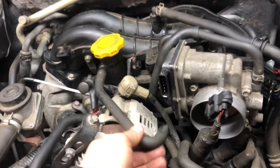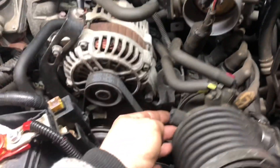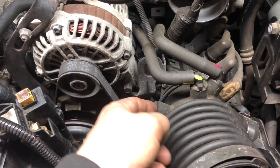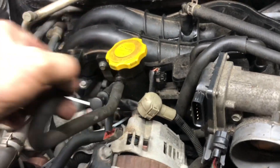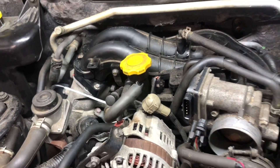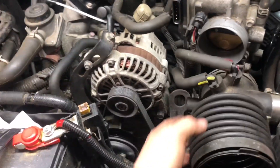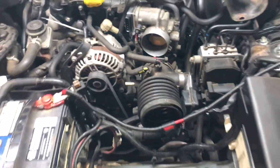As I was trying to replace the SSV solenoid, I discovered that this is actually broken — broken over here with a little piece stuck. It was pretending like it was connected. When I pulled it off, this plastic is super brittle. It's like a plastic pipe inside of a plastic pipe — real crazy. So we're going to update that really quick. We just installed this metal connector here, and now we're going to replace this pipe. No more broken pipe, no more airway leak.